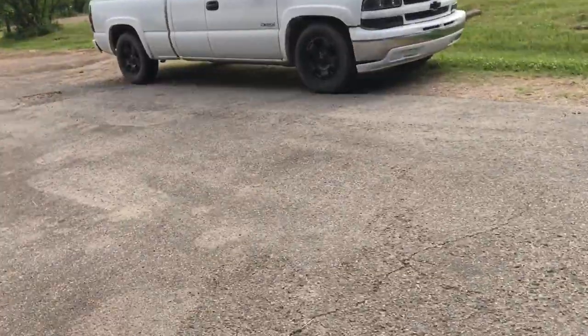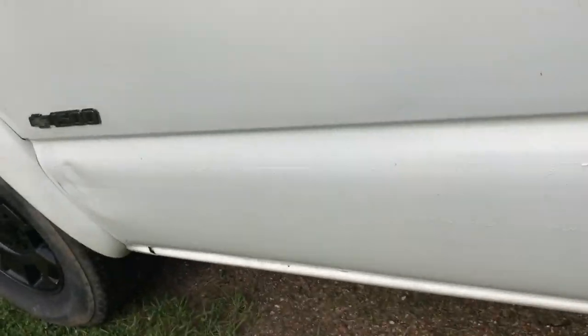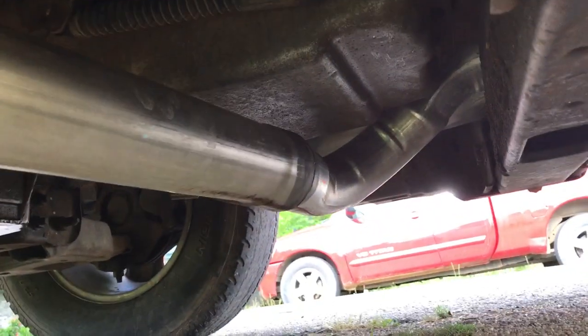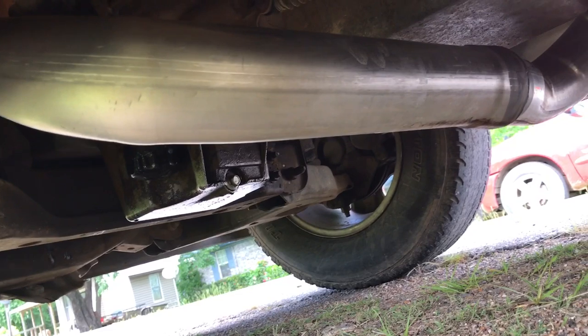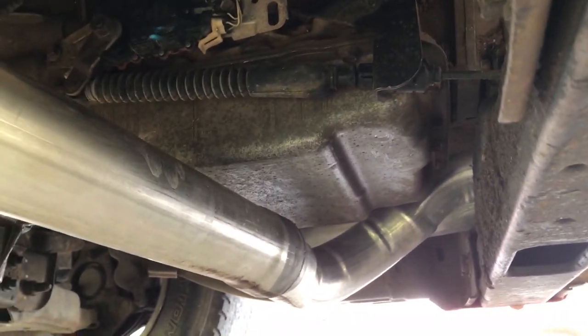Good afternoon guys. I came across a problem - my YouTube buddy 404man mentioned about my exhaust and my transmission. I'm gonna point that out real quick. It's probably gonna be pretty hard for me to change my transmission filter because my exhaust goes right under my pan. I didn't catch that when he was putting my exhaust on. More than likely I'm gonna have to unbolt that from the manifold in order to change my transmission filter. I hope I don't have to cut my exhaust entirely off because that's a lot of work.